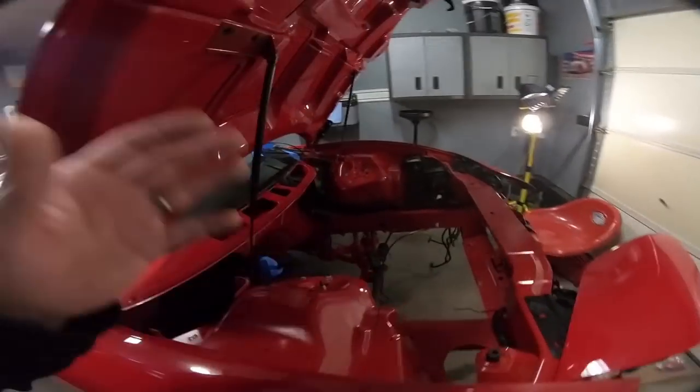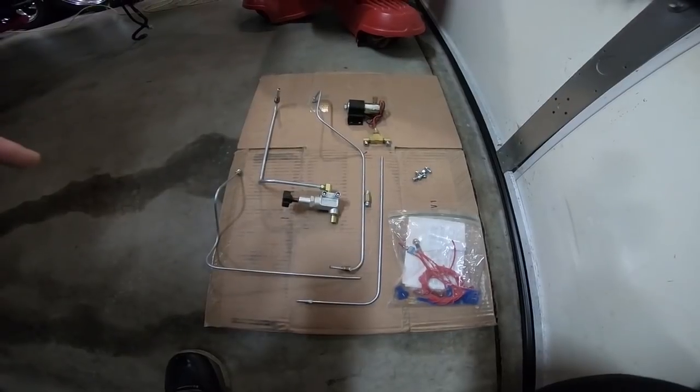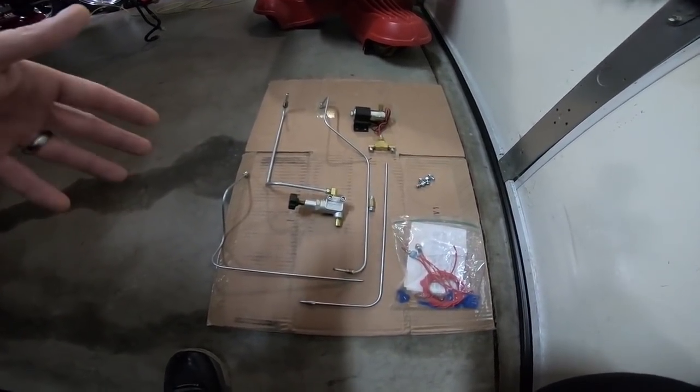well honestly, I have been putting this off. It has been one of the things that I have been dreading doing, but it is really the next step in our process on the Trans Am and that is installing an ABS delete and a line lock. I bought this kit several years back and just never put it on the car. It is set up for a three channel rear end with no traction control.